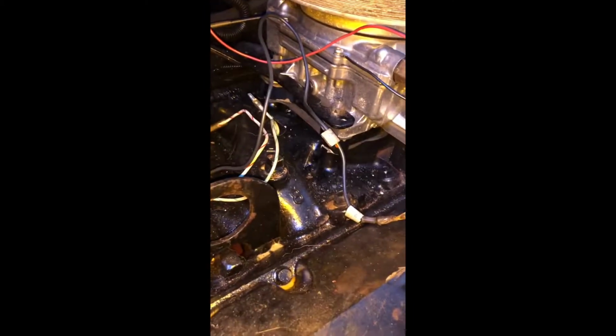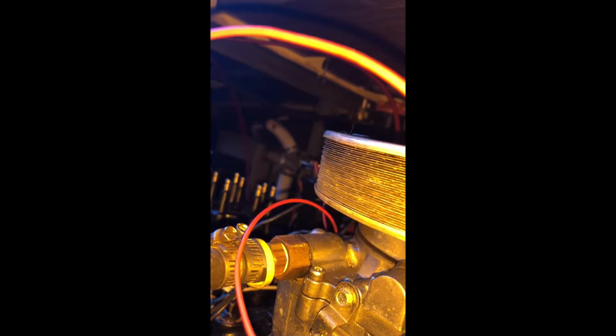All right, so I'm about to take this distributor off, but first I'm going to make a little score right here, because I'm hoping to not crank this engine once I have everything apart. Then I can just put everything back together and my timing will be pretty close, so I won't have to go crazy trying to figure out where this distributor was located. Later on I'm going to have to set timing anyway, but the closer I am, the better it is. All right, so I'm going to take this distributor cap off, and the distributor off. I'm not quite sure how this is going to go, so your guess is as good as mine. Allegedly, I can just pull it up and see what happens.